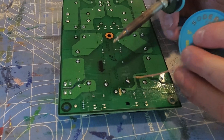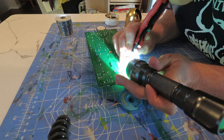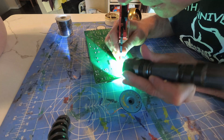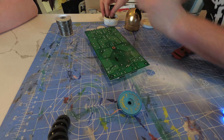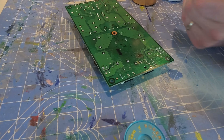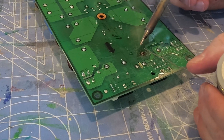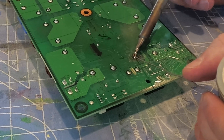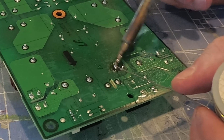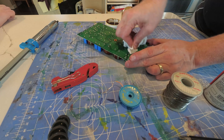To repair the joint, I used solder wick to wick out all the existing solder and used a utility knife to clean off the faces of the relay post — it seemed kind of ugly. I've seen others that just packed flux into the joint and re-soldered, but I wanted to try to clean off the post. Pack the area with flux and re-solder the joint as normal, making sure to get the joint filled and looking good. I kept seeing a black spot in the solder, like part of the post was sticking out and hadn't wet with solder. This is what makes me wonder if there's a problem with those posts that prevents solder from properly adhering, leading to this issue in the first place. If the problem happens again, I may see if I can source some new relays. I then cleaned off the flux using flux cleaner — alcohol should also work.